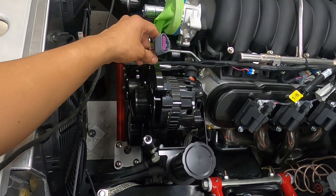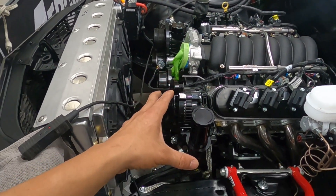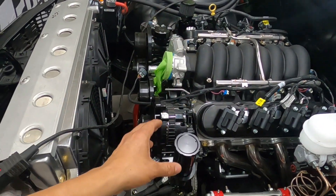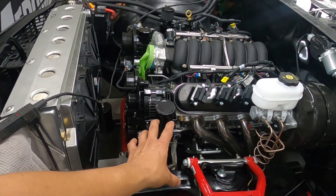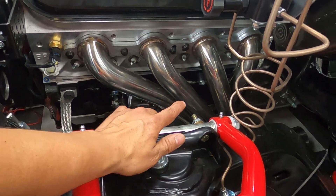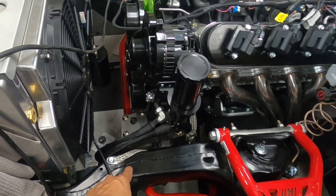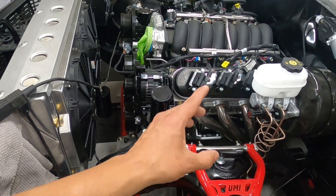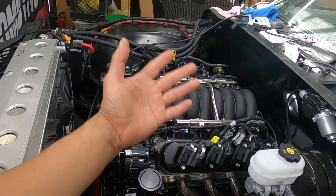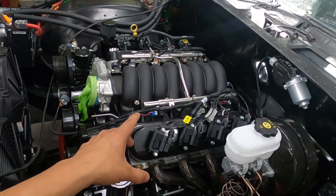That connector there is our mass airflow sensor — obviously we can't plug that one in yet. There are a few odds and ends we can't plug in until we get the rest of this thing laced up. For the most part, lace the wire up nice and neat and route everything away from heat. Down in the knock sensor area we made sure we got everything heat wrapped, tie wrapped, and away from all the heat areas. Also, make sure you spend a little money on their ground kit — PSI Conversion offers a ground kit that is really nice and dummy-proof. They literally give you a picture showing where to bolt the ground straps.